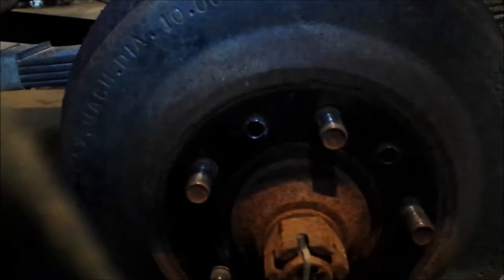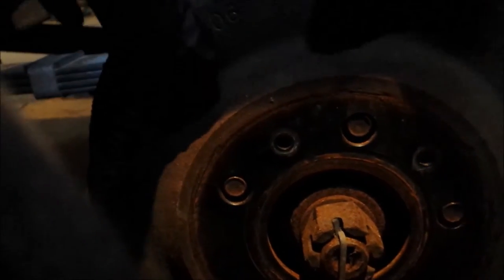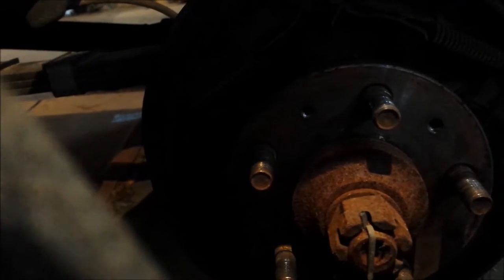So you won't have to hit the parking brake just yet. Go ahead and take those off real quick. Sometimes these drums will be stuck onto the axle shaft, but we get lucky today. One way to avoid this is by putting some lubrication like anti-seize on the hub itself. But like I said, we're lucky today.